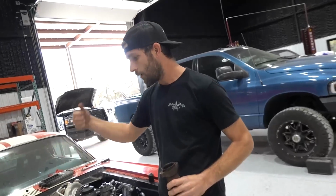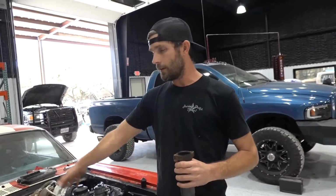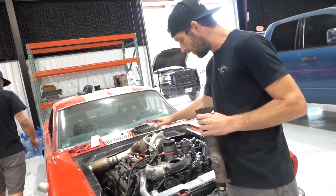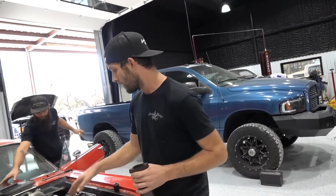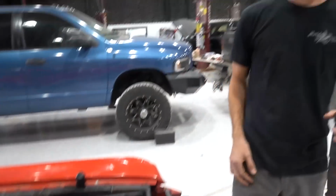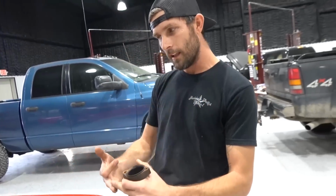Yeah, we pulled that down, ball honed the thing, cleaned all that up. Cause, well, there's another reason for that. But still, we were checking for metal in the oil. We were looking for everything. Get it running and it would run for about a second and a half and turn off. And then we started having reversion issues where we were actually blowing exhaust gas through the intake. And we're like, that's odd. How is that possible? No bent push rods, cam lobes perfect, lift is there.